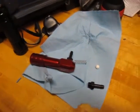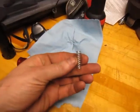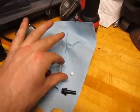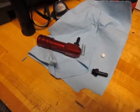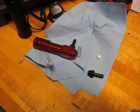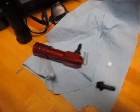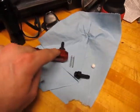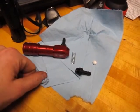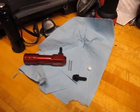So I took the boost controller apart — a little bit of oil on the ball, but nothing too bad. I have the upgraded pro spring, the one with higher resistance I guess, for more boost. The lesser spring only goes like 12 to 18 psi or something like that, so I put the bigger one in because I maxed out the other one. Anyway, spring looks good, ball looks good, these look good. This thing's pretty straightforward, there's not a lot to it — just an open hole, this thing pushes down the spring easily. Put it back in and see if that does anything; if not, we'll try blocking it off like people have said online and see what happens.